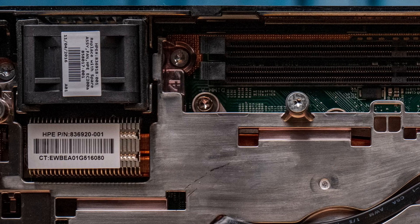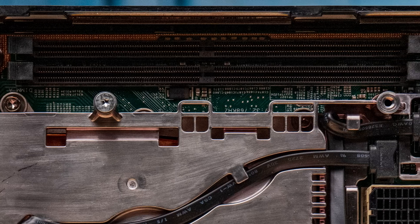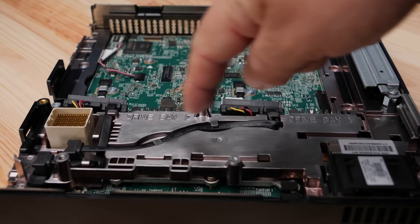When I first looked inside and saw the heatsink, fan, and DIMMs, I was confused — why is the Xeon D processor over there but the DIMMs further down? Usually DIMMs have to be a certain distance from the SoC due to memory trace lengths. It turns out the SoC is actually sitting under that plastic crossbar, with the DIMMs placed directly next to it.